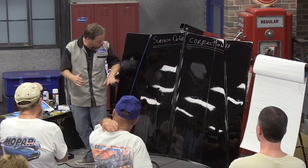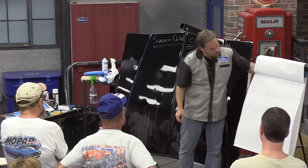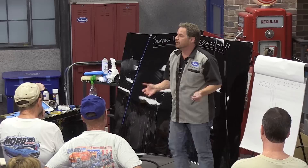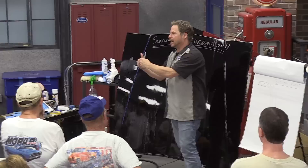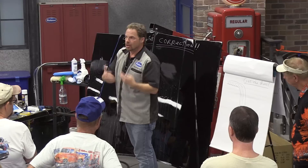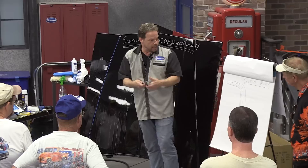I want to talk about eliminating runs in the paint. It's a necessary evil — it's like traction. You flirt with the living and breathing edge of traction with your car on the track. Once you break traction you lose control, but you want to ride that edge — that's best performance. Same with painting. You spray with your technique up until the point where you're putting it on wet enough that you're flirting with that disaster area of almost running the paint. You need enough on there for nice flow-out, nice DOI, nice self-leveling, and great gloss. You're going to have runs — everybody does. You sneeze, a bug bites your arm and you slip, your technique relaxes.